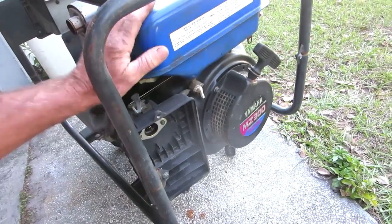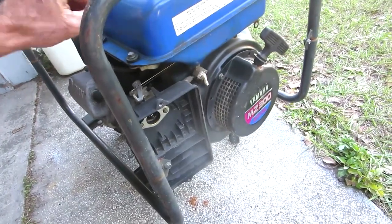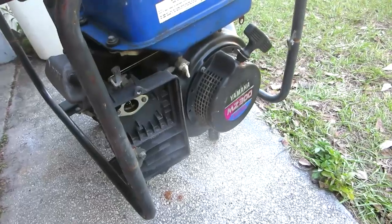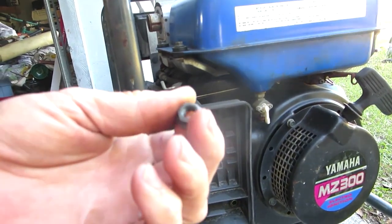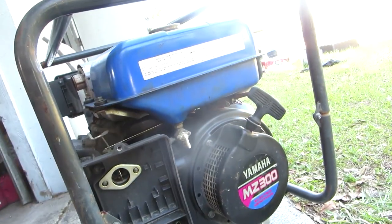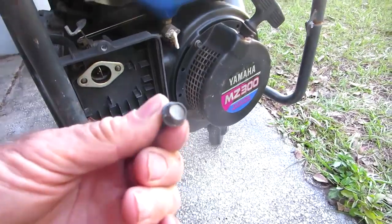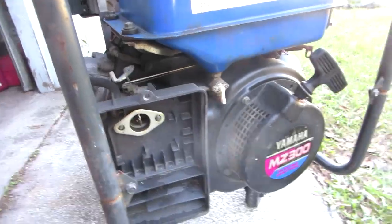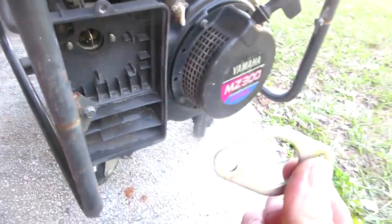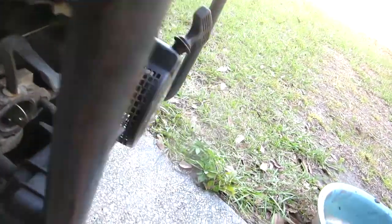Anyway, so first thing I'm going to do is get the fuel tank and dump it. Or I just take it off altogether. Oh, look at that, how convenient, the bolts are already loose. So, inside here, there's 2 nuts. I'm not sure, 13 millimeter, 12 millimeter. And then there's a screw down here, which of course it has to be a different size. I'm not sure, to tell you the truth. I think that's a 10 millimeter. My electric tools are elsewhere at the moment. So we pull those off there. Flange comes off there, holds it in there. There's a hose running from here to the back of there, and these hoses are all crap. And with those 2 nuts, that comes out of there.